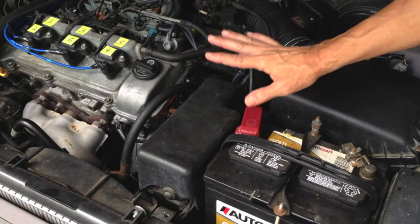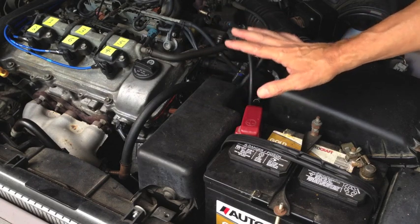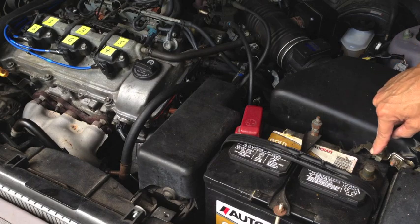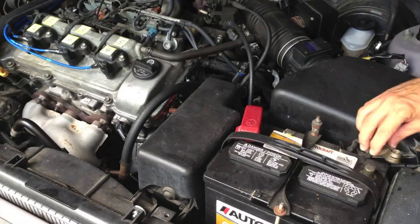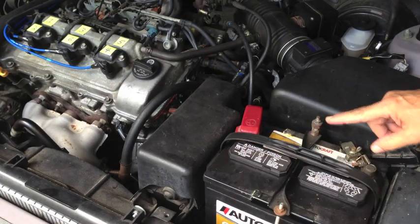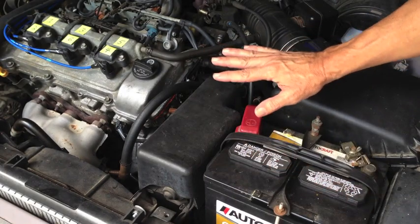This should still go on pretty tight even though it doesn't snap into place. Get these bolts tightened down. The next thing I need to do is clear the trouble code — clear out that P0301. I'm going to do that by disconnecting the negative battery cable for about one minute, then I'll put it back on. It's been about a minute, so I'm going to reconnect the battery. Doing that should have cleared the check engine light, so now I'm starting fresh.